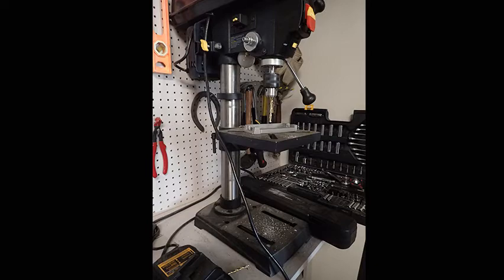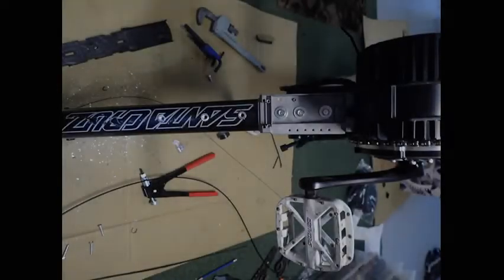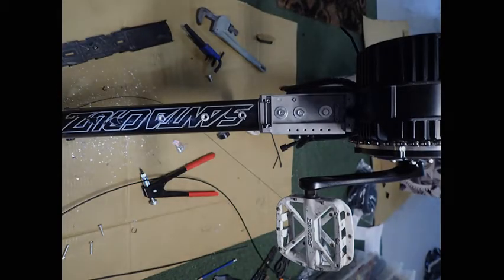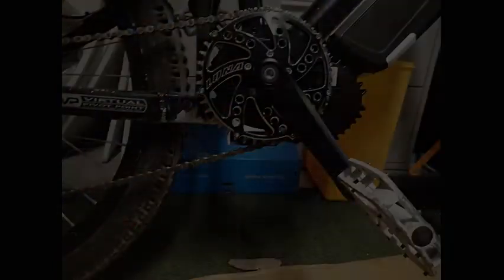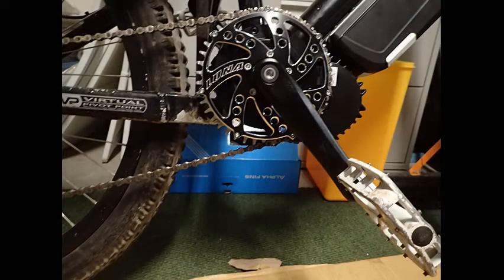You have to make your own holes in the aluminum plates, but those are going to be the most durable ones, so you definitely should do that. I bolted the aluminum piece in and then ran the wires from the motor right into the bracket. I was going to solder it directly, but there was lots of room so it should stay nice and tight with a connector inside. The battery sits pretty tight up against the motor, keeping its weight as low as possible on the bike.